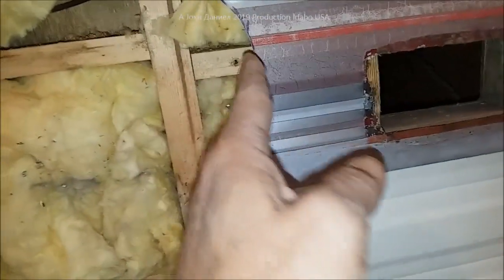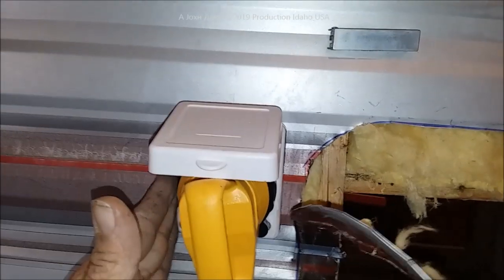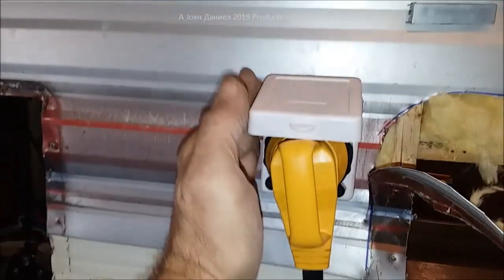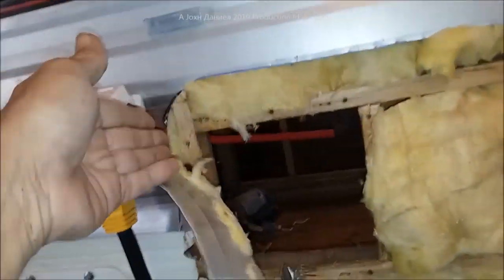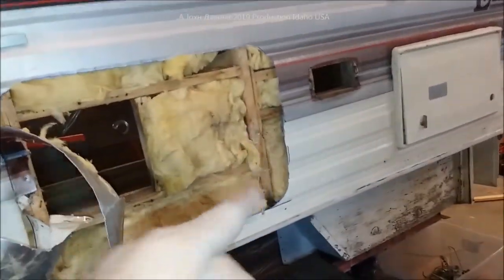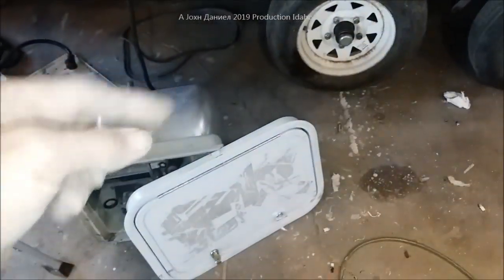Now the bad news is it puts me just barely into that corner with the screw hole right there. But with my flange depth - I specifically picked this one - it won't hit that. It'll go all the way in and touch but won't cause problems. When you open the door you'll see a little offset going into that area. I had to do it this way because there's a frame here under the window I did not want to cut - it runs right through here, too close to a major opening. Now I'm making a major opening and I will frame it in to install the battery area for my extra SLA sealed lead acid batteries.